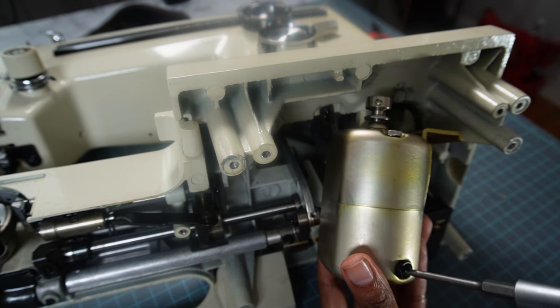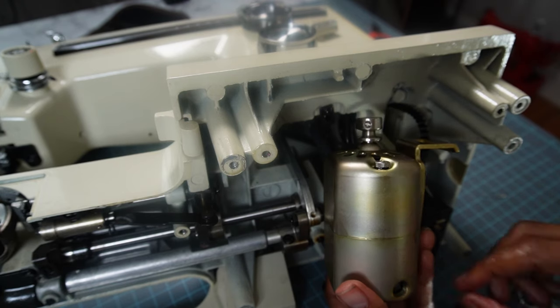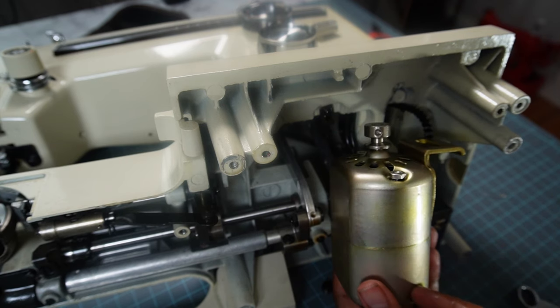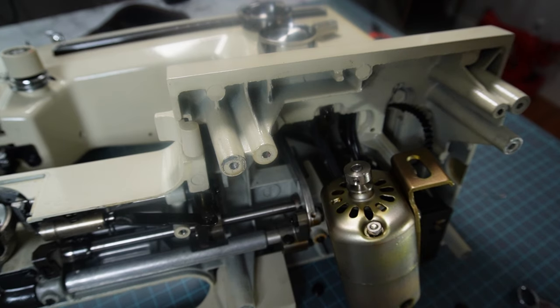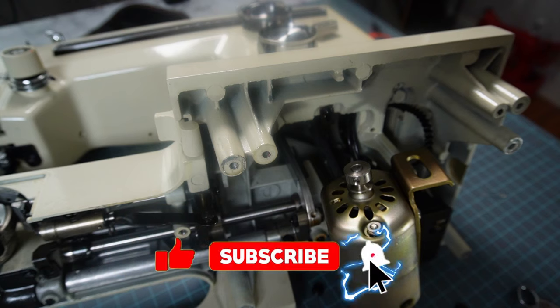Now I'm just checking the other motor brush that is on the other side of the motor, and already we can see that the motor brush coils are missing, and that is a problem because it will not allow the motor brush to sit against the commutator so that it can make contact. I'm going to change out the motor brushes to see if it does in fact change the performance of this machine and cause it to work. In the meantime, if you haven't already, please do subscribe and tap that notification bell to receive updates.